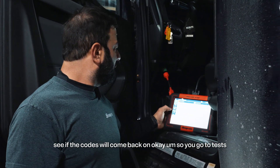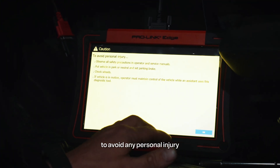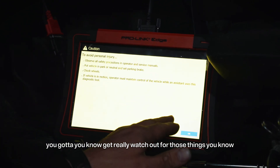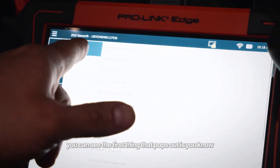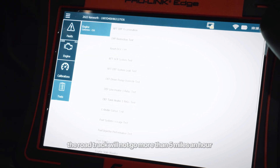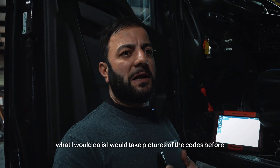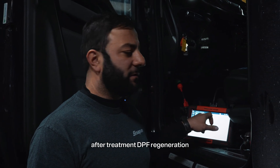So you go to test, hit Cummins, and you just got to read — make sure to avoid any personal injury, you got to make sure all the safety precautions are taken care of. Check the wheels, make sure the truck's in neutral. So right here, as you can see, a lot of these newer trucks have a lot of these regen problems — they're broke down on the side of the road and the truck will not go more than five miles an hour. You get there and it says that it needs a parked regeneration. The first thing you do — clear the codes, take pictures of the codes before — then come up here where it says after-treatment DPF regeneration. You boom, hit that.